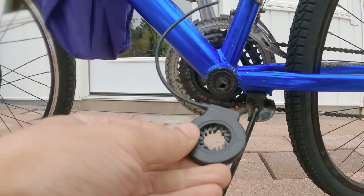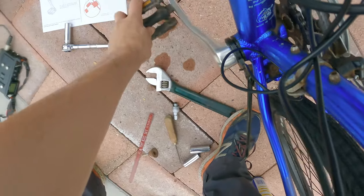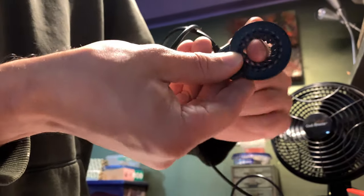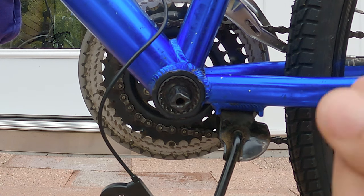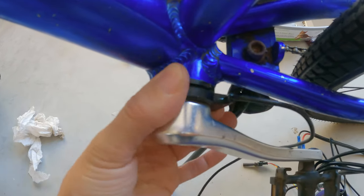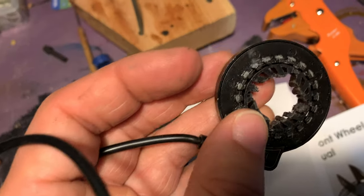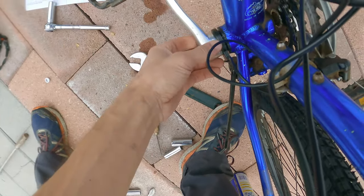Here's the stupid PAS sensor. The problem is you have to put it up against the thing that is spinning — your solid surface is up against your crank arm which is spinning — and the other side is a spacer, so the thing that actually spins is in the middle. The manual says it must be used with an Isis 20-tooth socket. I appear to have 20 teeth, but I couldn't get the PAS to fit into the teeth without modifying it to have a wider opening. It's plastic mounting into metal, and then you have your crank arm rubbing on the other side constantly causing friction. Obviously this works on some bikes somewhere, but it's just not a very good universal design.